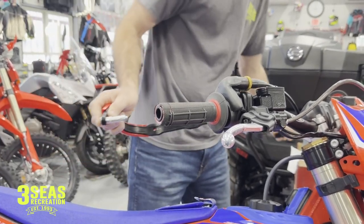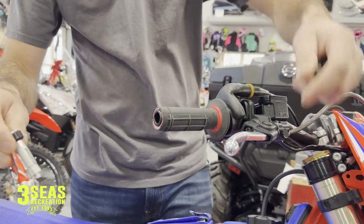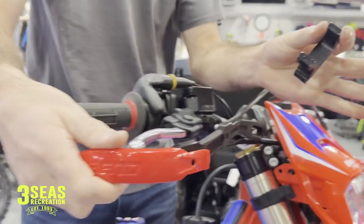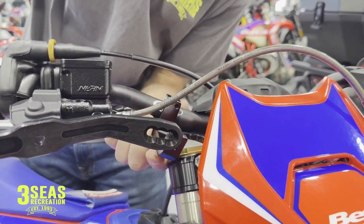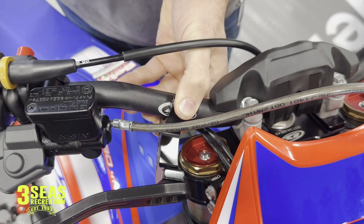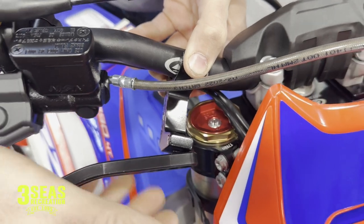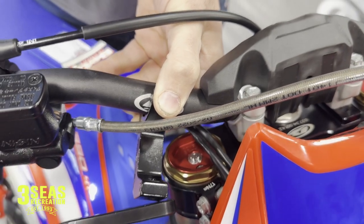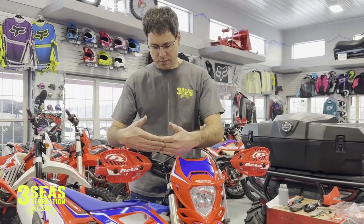We've got our bracket in the end of the handlebar — this is what's going to pinch and hold the internals. They do give you bigger ones for bigger bars in the industry, but that's not the case with the Betas so we'll use the smaller one that came with it. I like to use never-seize on the final assembly because after a year or two of dirt and water getting in there it can make it harder to come apart. I'll slide that in the end. One more modification: when I set this on here, the bracket has a pretty good angle to it — it's not completely flush — so I'm going to take it back in the vise and give it a kink right at the end where the bend has already started, so we have a tighter bolt there.